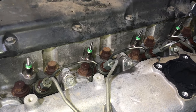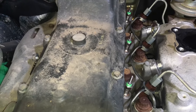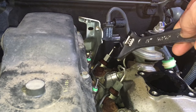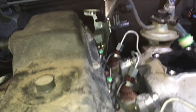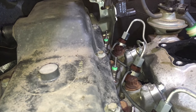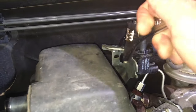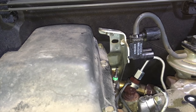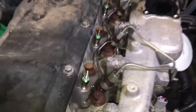If you can't manage this, contact me or one of our 4x4 diesel workshop partners. Glow plugs are torqued to 13 Nm and it's time to access the injectors. Since we tweaked that bracket back, it's now slightly in the way of the lines, so we bring it back to its original position with the shifter — just like that. Much easier than trying to remove the two bolts and risking them breaking off.